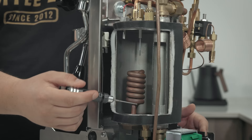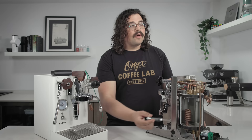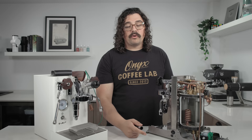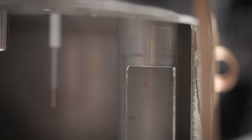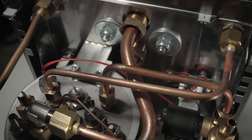What makes it a heat exchanger is that the brew water is actively being heated by the steam boiler. All we have is this big steam boiler and one heating element, but we have this tube inside the steam boiler. This tube is where water is taken in and heated by the heat from the steam boiler so you constantly have heated water coming to the group head. This works through something called a thermosiphon — fresh water is pumped up through this big copper pipe and into the boiler, where this fitting goes right into that brew tube to be heated up.